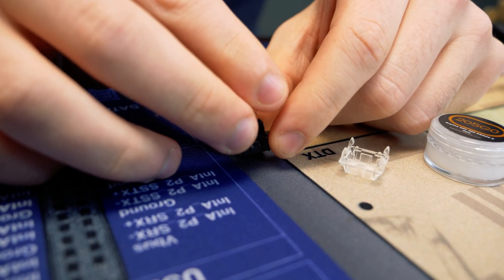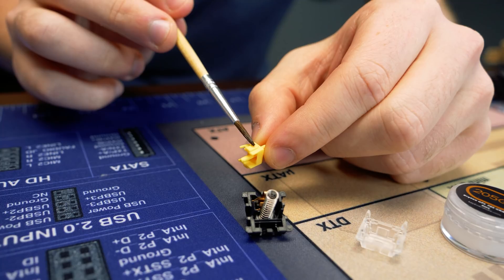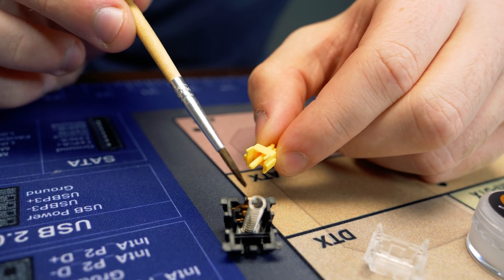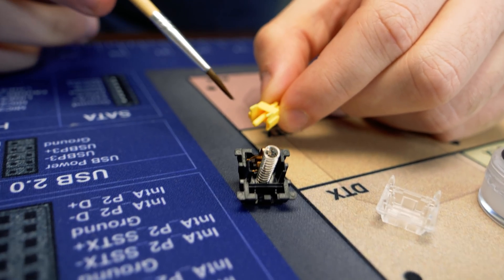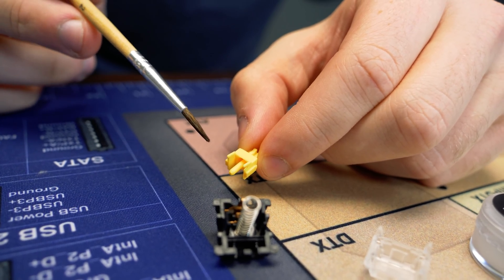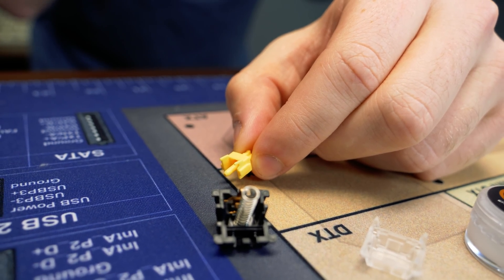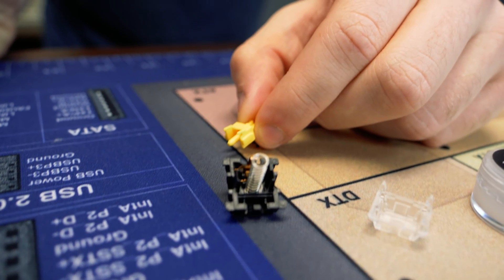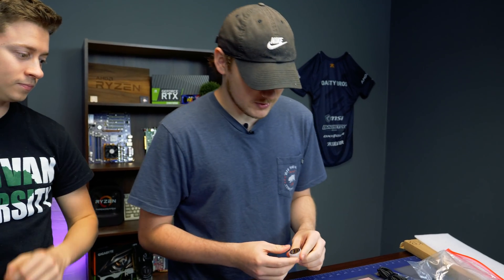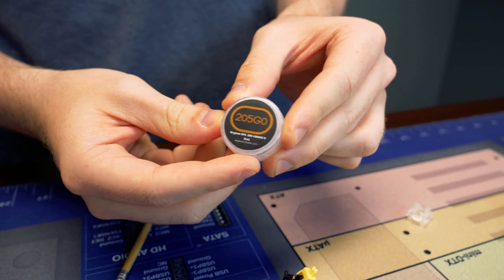Next, you put your spring in place and take your stem. On the stem, one side goes into the slider housing, and these are the contact points for the leaf — when these contact points actuate on the leaf, that's how you get your keystroke. You're going to want to lube the side that goes in the slider housings, and optionally you can lube the contact points as well. When you do that, it gives it a lot less resistance, and this is not recommended on tactile switches because it would kill the tactile bump. But for linears it's okay. I chose not to and only did the sides. The lube we used for this was Krytox 205GO — there are lots of different keyboard lubes out there, but this is just the one we chose.